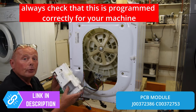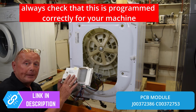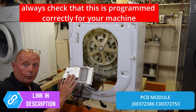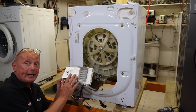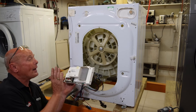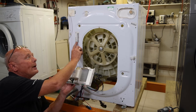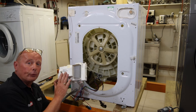There we have a good pre-programmed circuit board. You must remember: if you are buying new, the circuit boards need to be programmed. If you're buying secondhand, you need to make sure you're buying the circuit board only for the model it came off — they are pre-programmed, and only engineers in the UK will have equipment to program them. This is a WMXTF942P UK and it is only programmed for that machine.